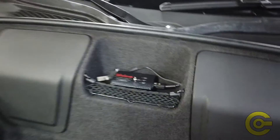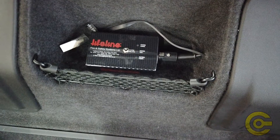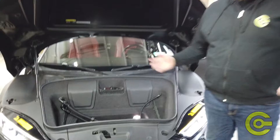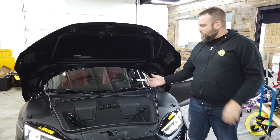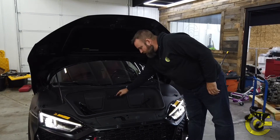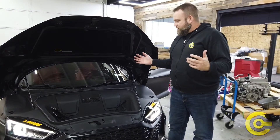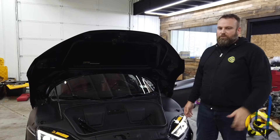When you press the button on the steering column, that's going to light up green — that's how you test the fire suppression. If you leave it on all the time, it'll probably last a while on the battery. But if you're not going to drive the car for a while, you'll want to put it back into center mode. Obviously, if you have any questions, feel free to reach out to us at the shop or through email.